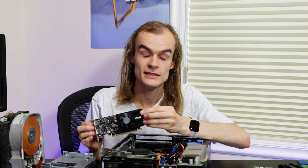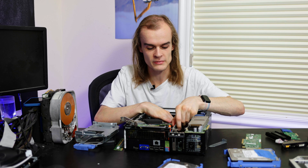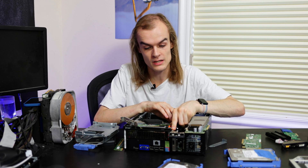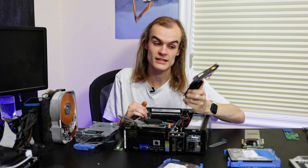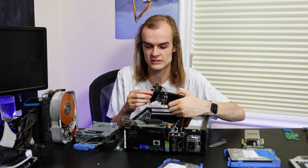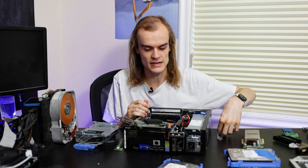For a desktop or heavier GPU compute use, here's a GT1030. This is pretty close to as fast as you can get, with the GTX 1650 being a little bit faster and about the fastest reasonable low-profile option for a system like this. I'm going to slot the GT1030 in here, and unfortunately that only leaves me with a 1x slot which really limits my options. I could put the GT710 in and drive a total of four monitors, but I don't need that right now, so I'm just going to leave the second slot empty and put the slot backing back on.